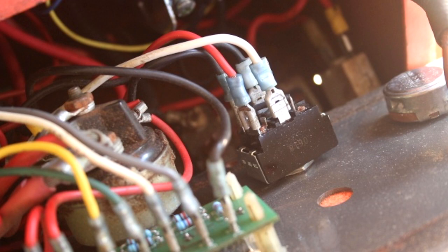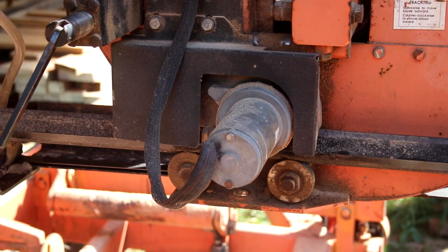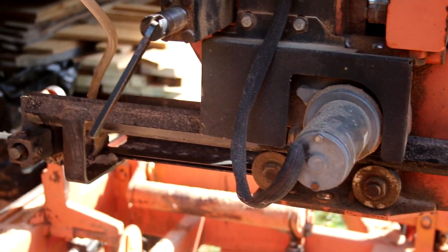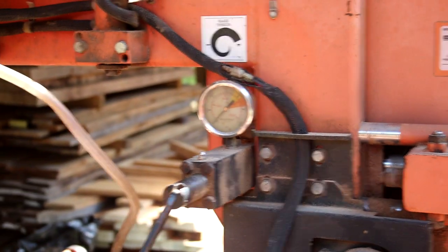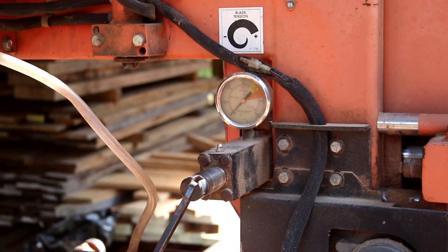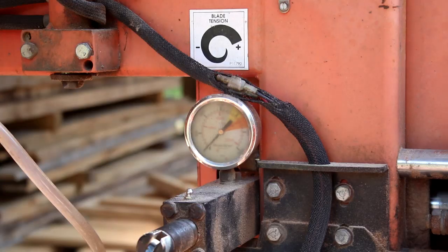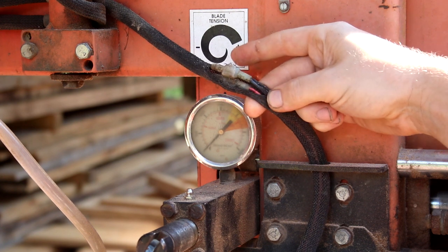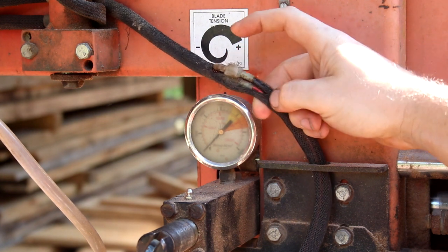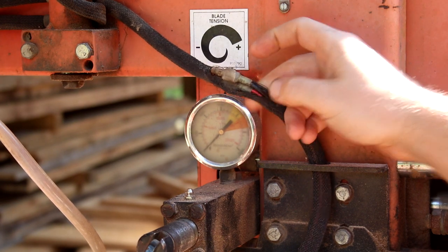In my case the switch was working properly, so here is the motor on the machine for your guide. You're going to want to follow that loom covering the wires, right there. On most machines you'll have a connector here, and you'll want a test light on these wires. These two wires are not ground and power — both are power signals: one makes the guide go left, the other makes it go right.